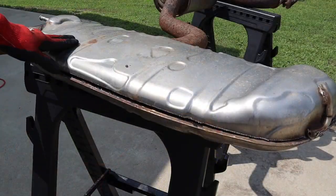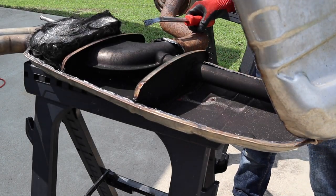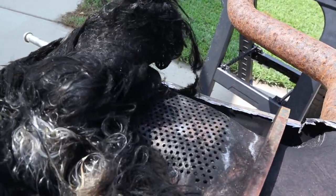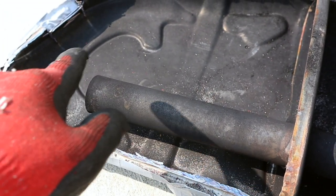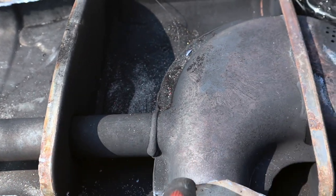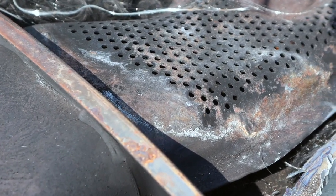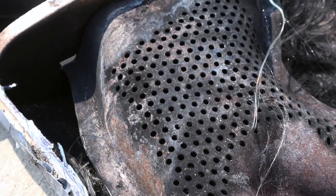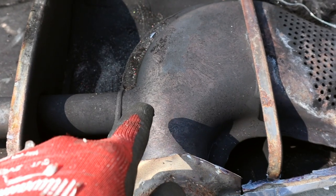This suitcase style is the rear muffler on the vehicle. These are threads of fiberglass that will deaden that exhaust note coming out. You'll notice that there's different baffling inside of this muffler — this is actually all pretty sophisticated. The placement of these things is tuned to produce different exhaust notes. On the factory exhaust it's about quieting, especially at idle, but still having good flow. These pieces can be moved around, the dynamics can change, and the exhaust notes can change — that's why different manufacturers' exhausts can sound very, very different.